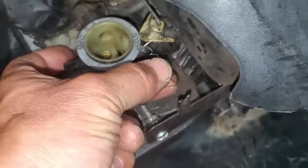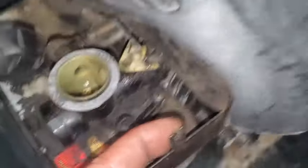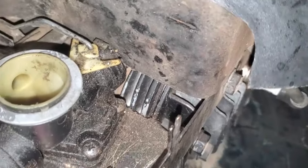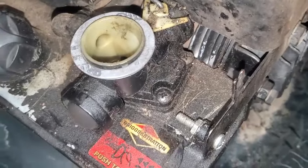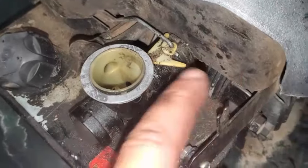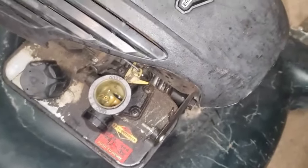I did find the spring. Let me get that back on there. That spring is just going to go back on here between that little hole there and right here. And then once we get it close to being the right RPM, we should be able to bend this tang that way or that way. Bending it out that way increases RPM, so pulling this governor arm this way is going to increase the RPM. Increasing spring tension will make that happen.